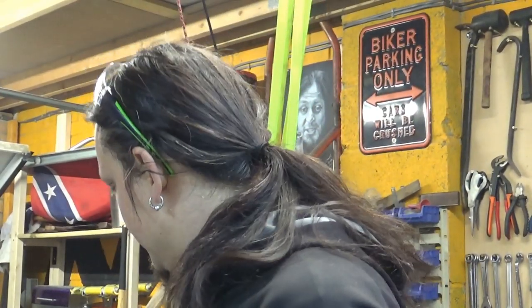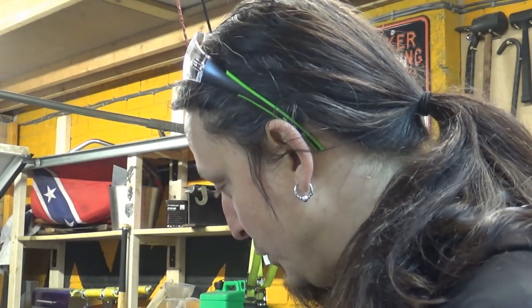Right, so it's not perfect, it's far from it, but the main issue, which was bogging under acceleration, when you twist the throttle, the bike was just completely dying and it would not run off the choke. That's been eliminated. It's far from perfect. It's misfiring like crazy, but I can see there's a blow in the exhaust where it goes 2 into 1, smoke coming from there even right now. So that is probably contributing to the popping and banging, and obviously there is no airbox.